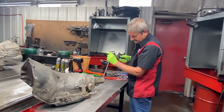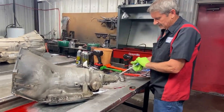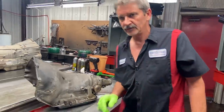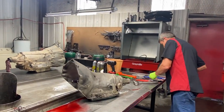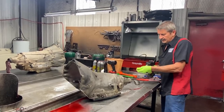So we'll get this rear seal out of here first with my universal screwdriver, get the rear seal out. And now we are going to grab a 9/16 deep socket and get the tail housing out of here.